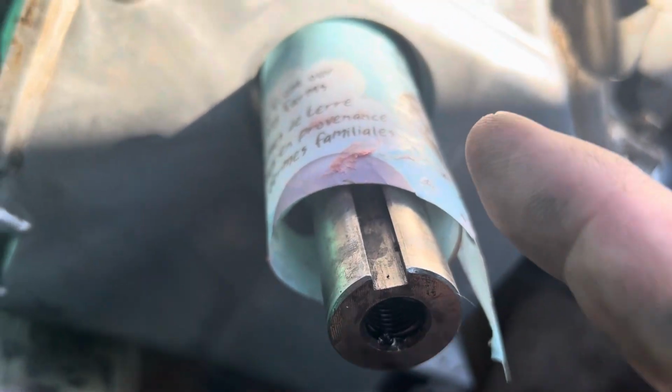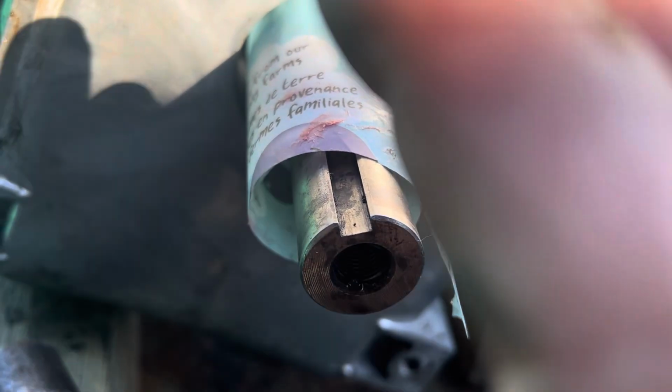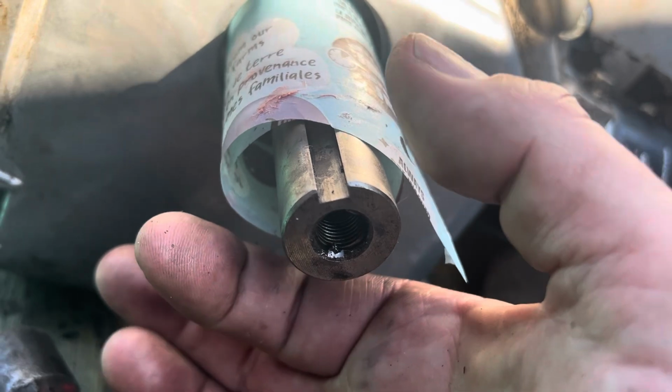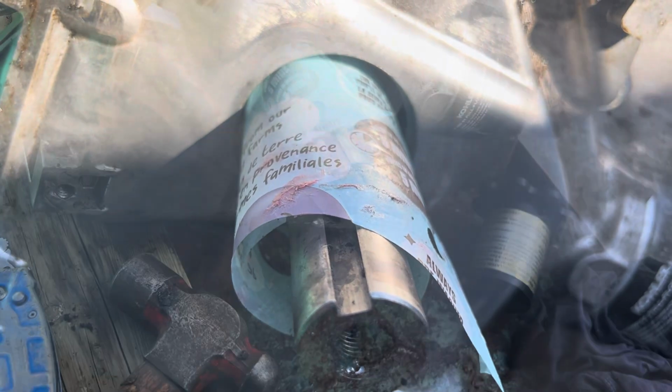We're gonna put the plastic around the crankshaft first, so it's a little bit tight, and then I'm gonna slide the seal on. Same idea, it's just I couldn't get this plastic to go around the crankshaft very easily. We'll taper this end, so right here will be a little bit smaller. That seal will go on nicely and slide all the way to the other end. At least that's my theory.